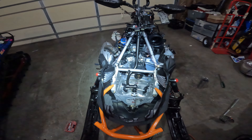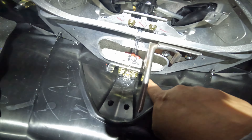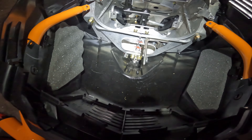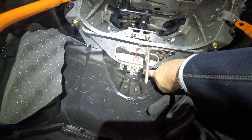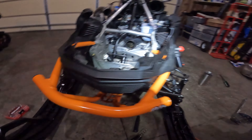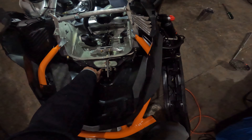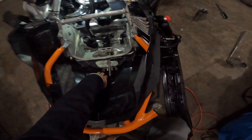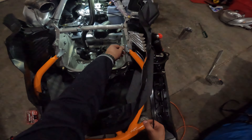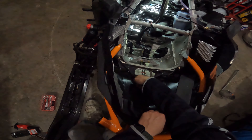Okay, I steered you all wrong. Before putting the bumper in and hooking up this hardware, it's a lot easier to drill these out first. So I did one from the bottom. Yeah, definitely easier to drill out the rivets that hold the nose corner first. I got one out, I just got to work on drilling the other one out. So: before you put the bumper in, drill these rivets out — quarter inch — then slide the bumper on. I got the top hardware loosely mounted now and I'm going to put the bigger hardware through these holes here.